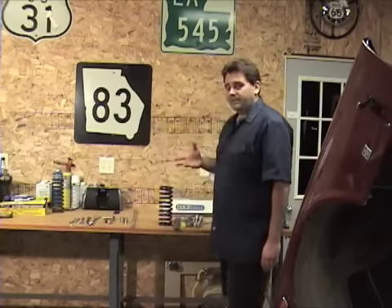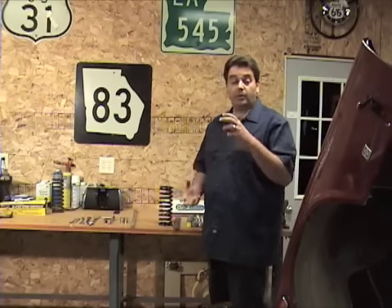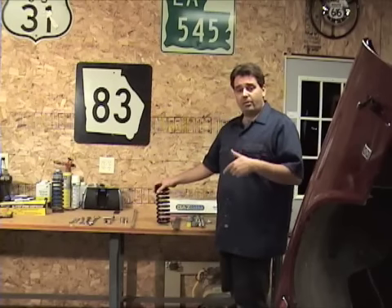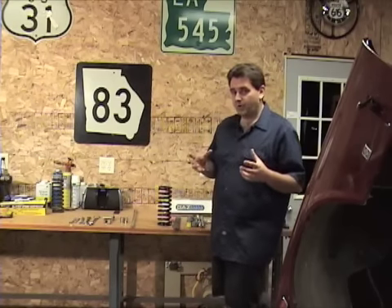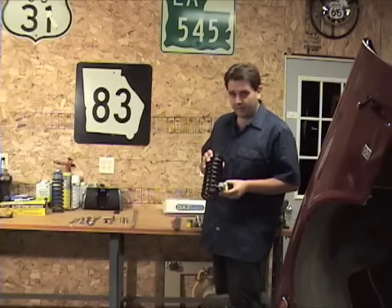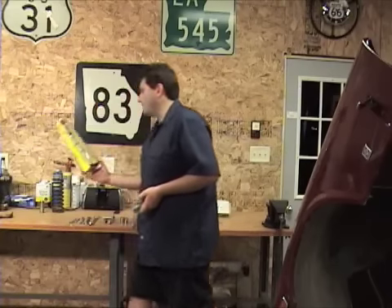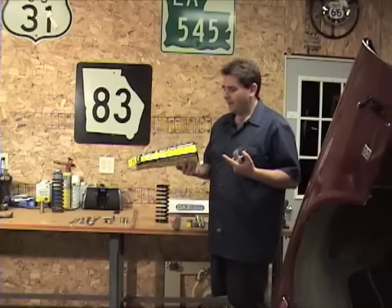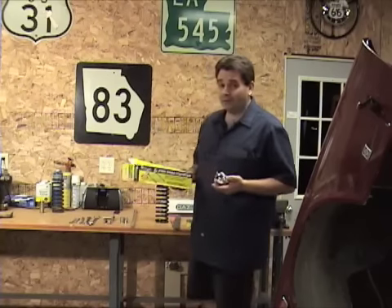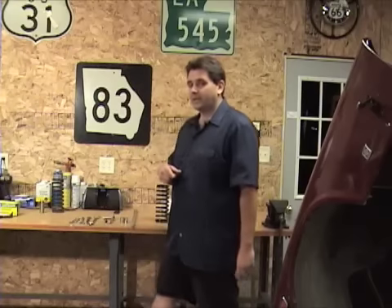A couple of tools you're going to need for this installation: you're going to need a set of spring compressors. You don't need the ones used on a front wheel drive car — those are great big and those springs hold a lot of energy. These don't, so you don't need anything super expensive or high end. A real nice thing about these smaller ones is they fit in between these springs — they're real tight. This particular set I bought at Harbor Freight, I think it was $10 for the pair. I definitely wouldn't recommend using these spring compressors for changing struts on your front wheel drive car, but for this application they're perfect.